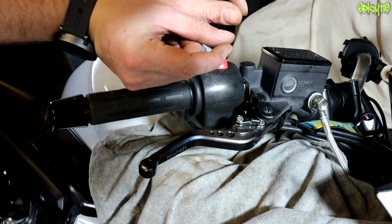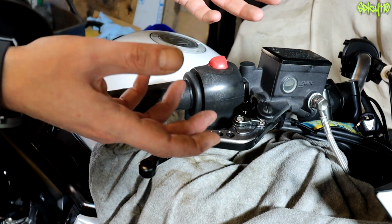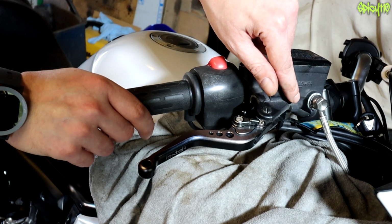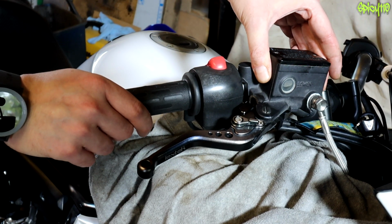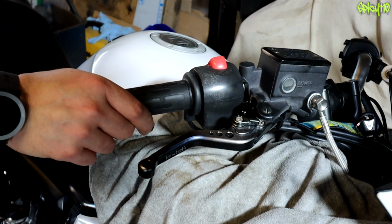When the pads shrink, then they move closer in towards the brake disc, increasing the space inside the calipers, which means there needs to be more fluid used. So if you use your brake pads really quickly, your fluid level is going to go down really quickly. You see, it's connected. That's basically why the reservoir is there, to replace the fluid in the volume that's made possible by the brake pads wearing down.